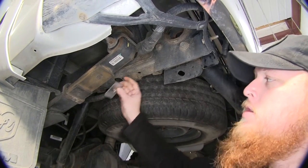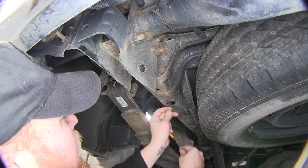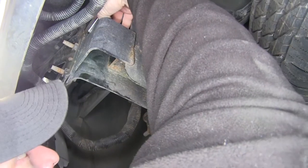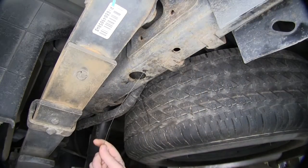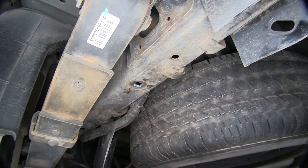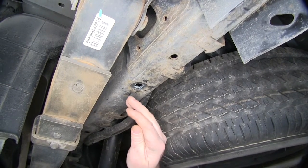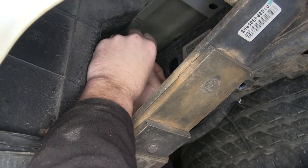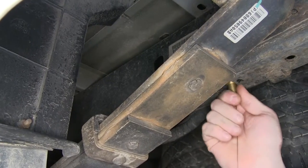For the front mounting location, we need to get the skinny block into position over the hole. We'll put a small hook on the backside of our pull wire and push it all the way out the back of the frame rail. Once we have it at the back of the frame rail, we'll hook on and pull it through until we get it over the hole. Once we get it over the hole, we'll pull the fish wire out, invert it where the coil goes through our block and out the access hole. Once we're out the access hole, we'll go ahead and thread on that carriage bolt, slide it into the frame rail, and pull it through the mounting location.